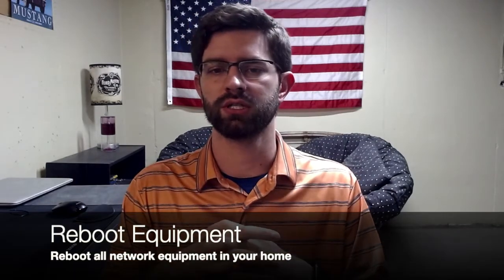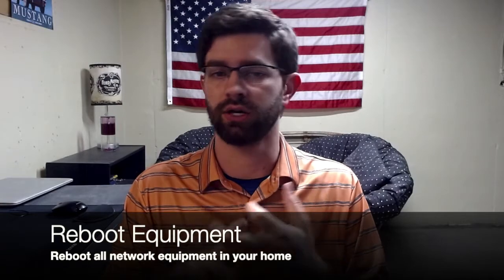First off, at a preferred time for you, reboot your system. Power down your modem, your router, and if you have one, a switch. You want to power down your modem for 60 seconds, plug it back in, wait 30 seconds, plug in your router if there are two separate units, and then wait 30 seconds and then plug in your switch if you have one. Once everything is up and running, go ahead and check all your network speeds.